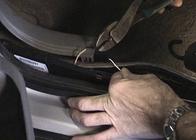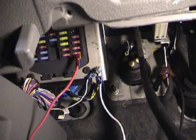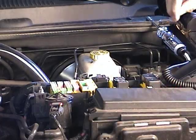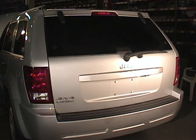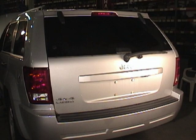Next, cut the wire. Attach the yellow wiring connector on the brake light relay to the wire from the cold side of the brake light switch. Attach the blue wire connector to the wire going to the rear of the vehicle. Now connect the remaining white wire to any suitable ground. Reinstall the brake light fuse, which you removed after you cut the cold side of the brake light wire. Test to make sure that the brake light relay functions correctly. With the towed vehicle's engine running, the brake lights work normally. When the towed vehicle's steering is unlocked, usually by turning the key to the tow position, the brake lights do not function.